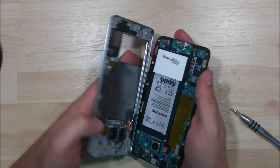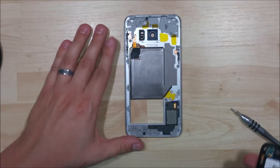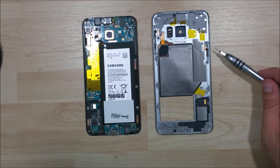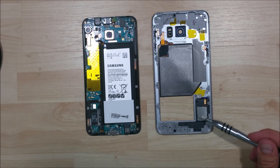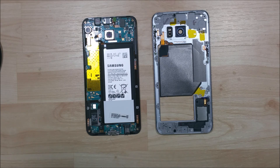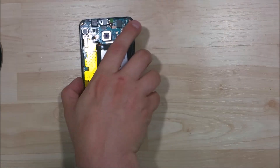So you can see there's a charge mat, then you have to undo that and the phone just comes right out. It doesn't look like there's any adhesive holding that back portion on to the midframe of the phone. So you can see in here we have our power button contact, our volume button contact, and our loudspeaker down here as well. This is normally the four points where there would be adhesive, but it doesn't seem like there's anything there. The phone has popped right out, which is kind of nice.